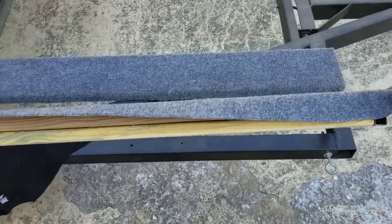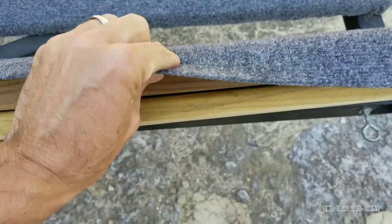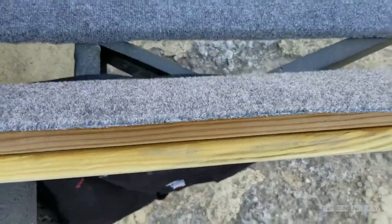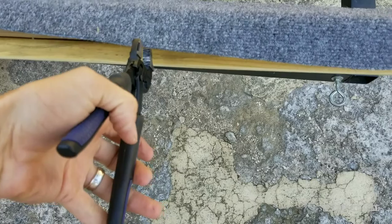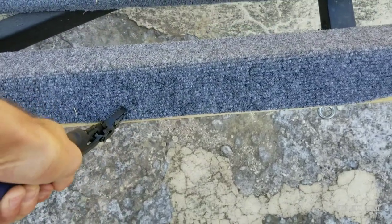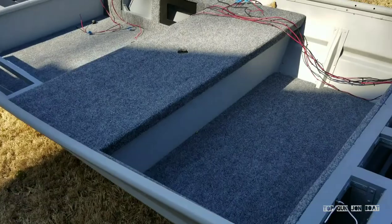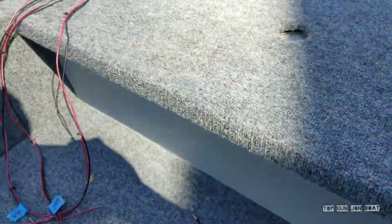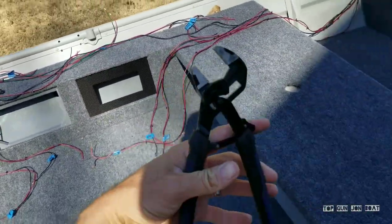Here's another little trick I do when I do any upholstery work: you can pull this with your hands all day and try to get a kung fu grip on it. But what I do to get it super, super tight and alleviate stress on my hand is I take a pair of pliers and grab the carpet, and then I can crank all my body weight into it and get it as tight as I can. That gives me a really good roll on this edge — that's how I've done all the carpet work inside the boat. It works amazing when you're wrapping edges to get that super, super tight fitment.